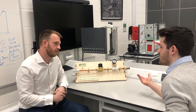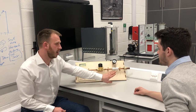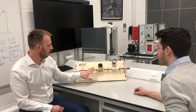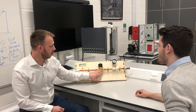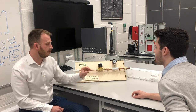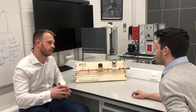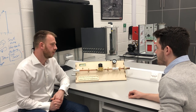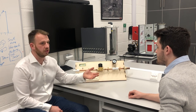For improvements, next time we would go for a digital pressure transducer that has a high refresh rate and record pressure upstream and downstream, so we'd be able to graphically see how opening and closing the solenoid valve decreases the pressure spikes. We would also use a more expensive, fast-reacting solenoid valve so we can have those open and close rates quicker, and record more valve delays – opening and closing more times to get a more defined graph and see how the relationship is. Overall, it was a success. We proved that we can reduce water hammer using software, and therefore it can be implemented quite easily into washing machines, dishwashers, and the domestic sector.